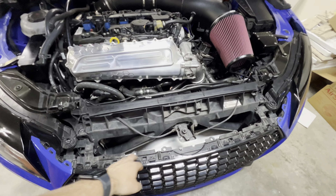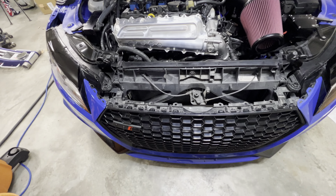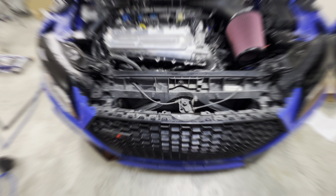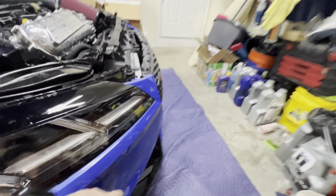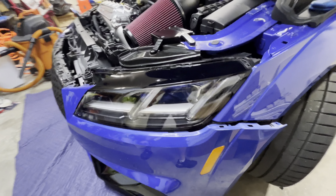The first thing I did is remove the cowl — there's just a couple fasteners that hold that in. Now I'm going to get the front bumper off. There are T25s, three along this side, then one that comes up in. Once they're removed you can pop it off. There are two T25s along the bottom, and then T30s along the front. I did the same thing on the other side — you just pop it off. There are two T25s right here as well.